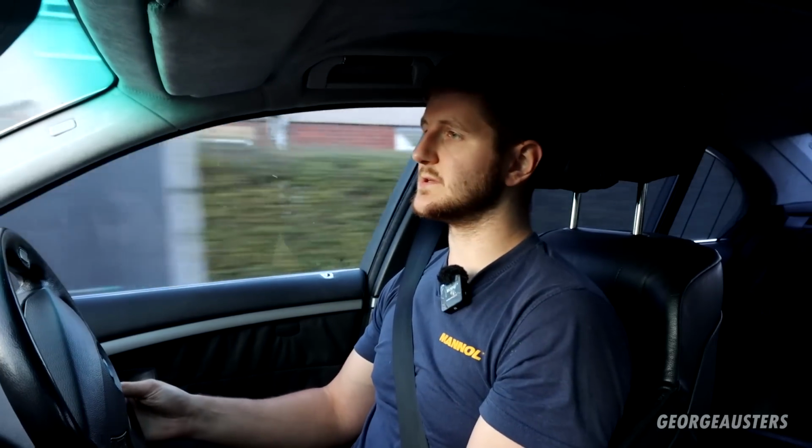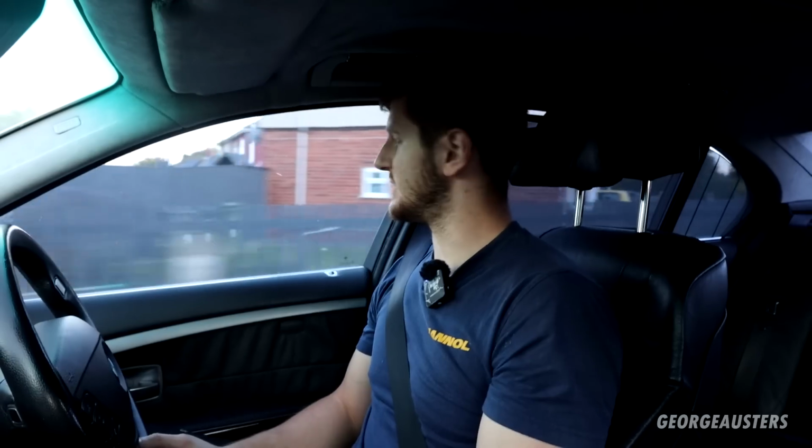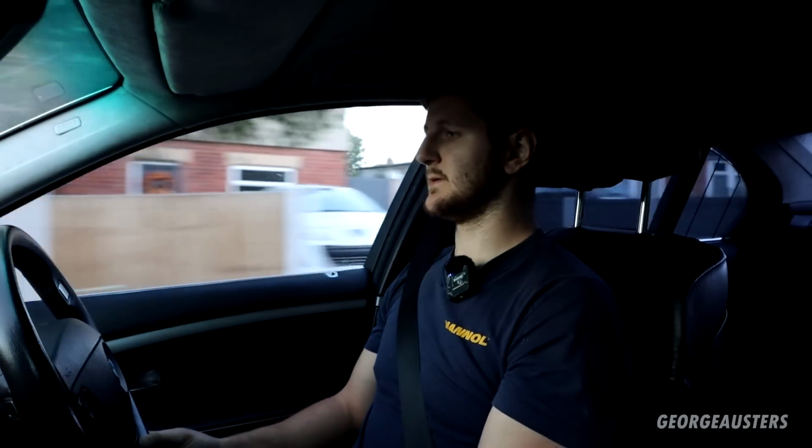I've heard different opinions. Some say that you should expect an engine management light. Some people say you won't even get one, but you'll get hidden fault codes. I'm talking about the secondary air pump delete, by the way. I mean, we must have some sort of error because it's not plugged in anymore, so we don't have any sort of signal going to it. Ah, that's a good point.